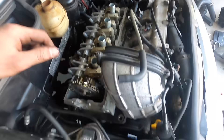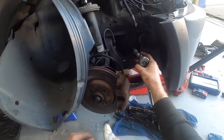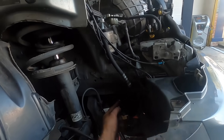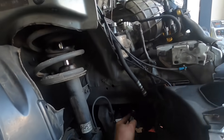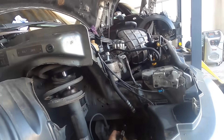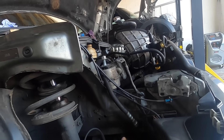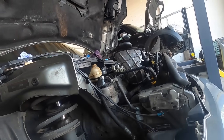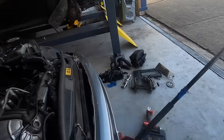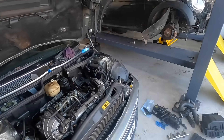I'm just going to do a few revolutions by hand just to make sure it's turning. If it wasn't in time it would get stuck on the valves, so we're just turning it through - give it a few revolutions. It seems all good, so let's get it all back together, get some oil in it, and flip the key.